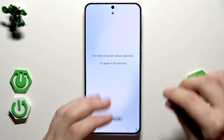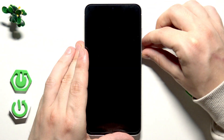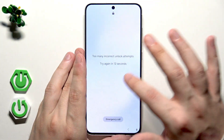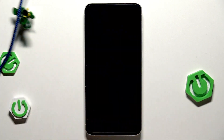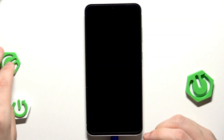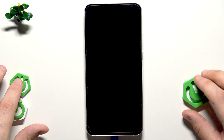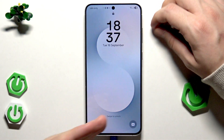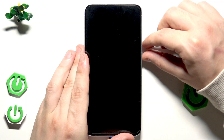We need to power off our device, but on Samsung it works in a specific way. Even when we want to power it off by holding the power button and volume down button and clicking power off, the phone asks us to type the password. So we will have to perform a force restart. But before we do it, let's connect our device using the USB-C cable to a PC or laptop — it can be Mac or Windows. Now we need to perform a force restart: hold the power button and volume down button at the same time until the screen turns off, and at the moment it turns off, we need to switch — stop holding power button and volume down, and start holding power button and volume up.